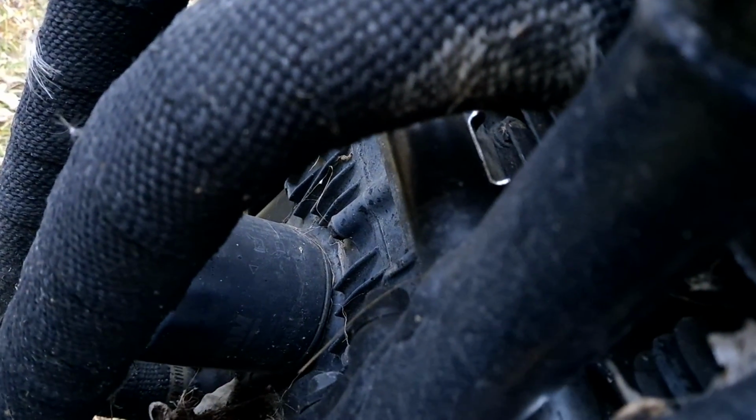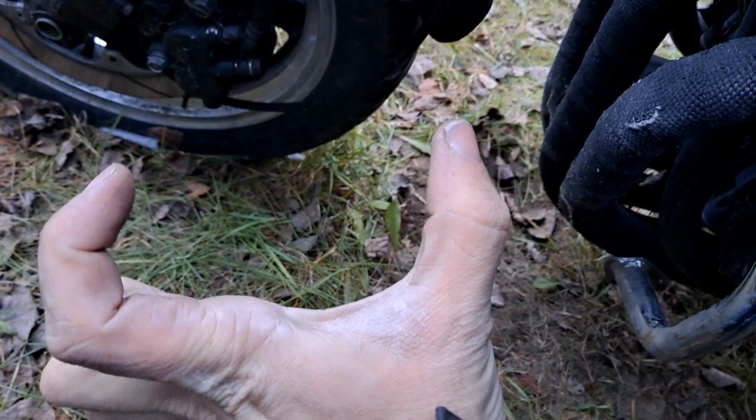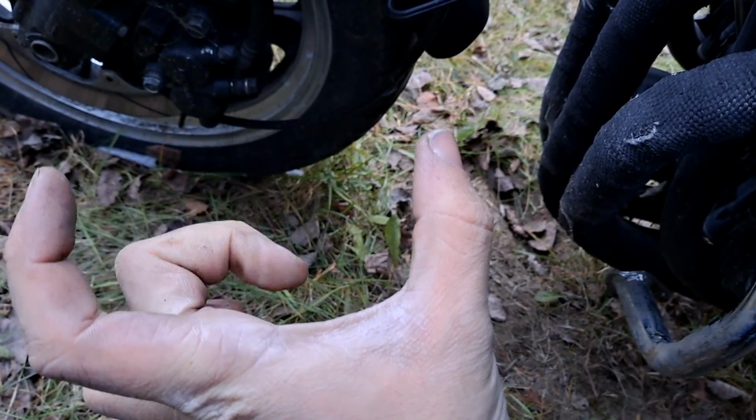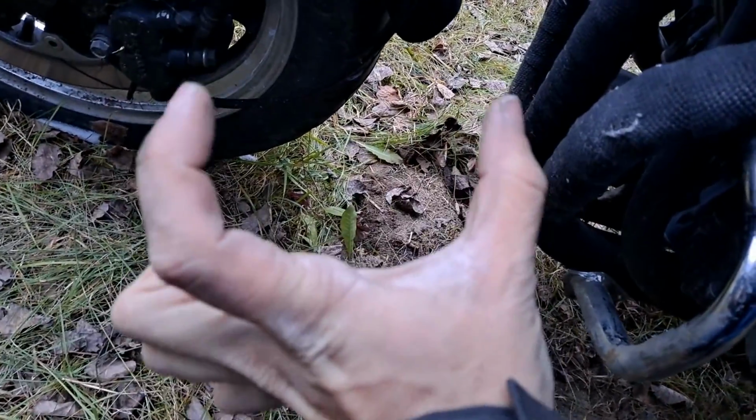But this Hondaline one is supposed to also use steel clamps. Steel clamps go around that horseshoe section. You can see there's a chunk of metal that's shaped like this to retain the band. So the band goes in here, wraps around in there, and then these two fingers keep it from walking around. And then you just tighten up your hose clamp, steel band, or whatever, to this horizontal black frame piece.